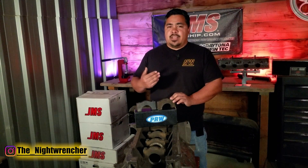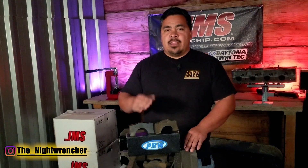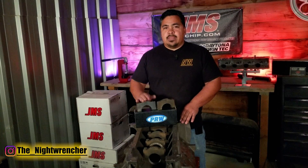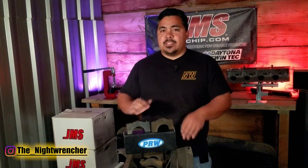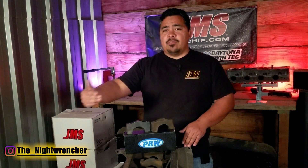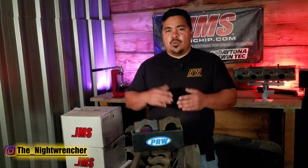You have to be honest with yourself and ask: am I really going to be pushing this motor as hard as I think I am? Is it really going to be worth it in the end? Do I really have enough invested in the rest of the block to add another $1,500 on top of that to protect it? Granted, newer motors may not require billet caps until much, much higher power levels, and a four-bolt main block will take more abuse than a two-bolt main block. So what might work for some might not work for others — you're just going to have to figure it out on your own.